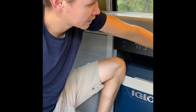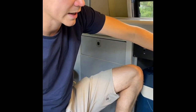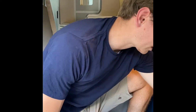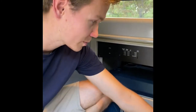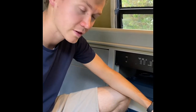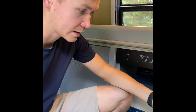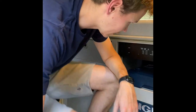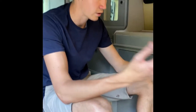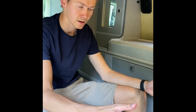You'll notice there's also another plug here — this one is for when you're plugged in at a campground with shore power. I'd recommend just not worrying about that and using the power plug down here all the time. We recommend not using high-voltage equipment like a griddle or hair dryer on this power. A laptop, phone, or watch is totally fine. If your battery gets low, it recharges when you drive — so if you're camped in the same spot for a long time, just give it a drive every day or so to keep the battery full.